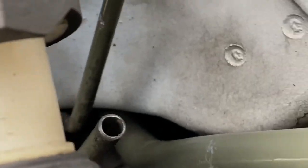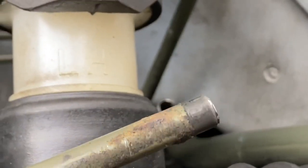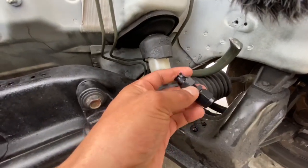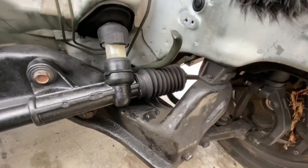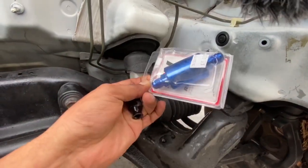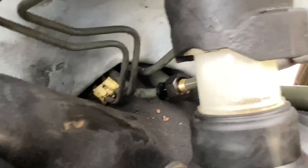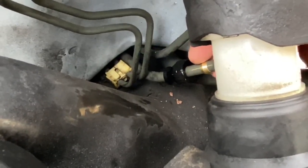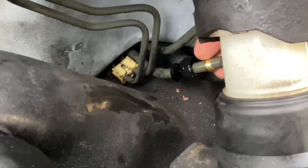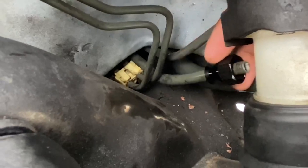Alright guys, that's what it looks like after it's cut — nice and smooth edge. Also, you guys want to make sure you never use anything electrical that's going to cause any type of spark to do this, because obviously you're dealing with fuel. Here's what the fitting looks like — it is a 5/16 hard line to female AN6 threading, so that way it'll fit the universal fuel filter which is also AN6. I'm gonna add it on there and show you guys. The fitting tightens up to the end fitting and this little gold sleeve is what's going to create the pressure seal so it doesn't leak, and that's what converts it into the AN6 line.